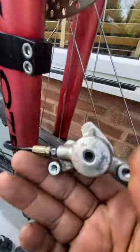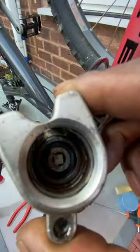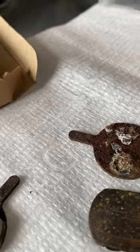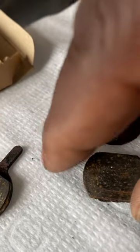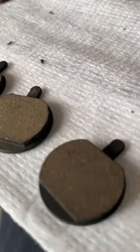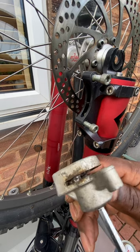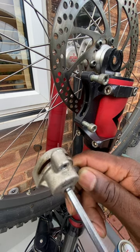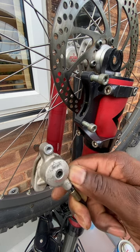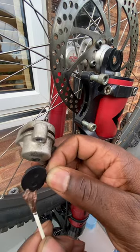This is what the brake cylinder looks like. I'll show you inside the cylinder. As mentioned, one brake pad fell apart, but I managed to locate another set with a shorter paddle - they are exactly the same dimension. What I've got to do is just withdraw the piston adjuster; you can see there it's a piston adjuster with a hexagon on the outside.